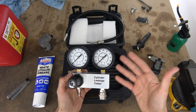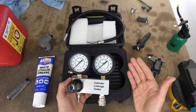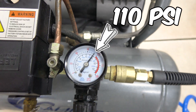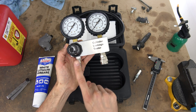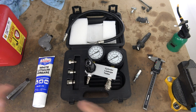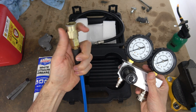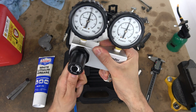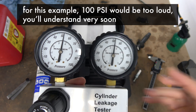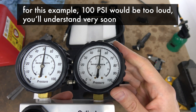You need to have an air compressor that goes at least to 100 psi, but that should really not be a problem because even my very small air compressor goes over 100 psi. We're going to connect right here, and this here is going to be connected to the engine. I'm going to simulate that now just to show you exactly what it looks like. So this here is connected to my air compressor — I'm roughly around 52 psi. You can see the exact same reading between the two gauges.